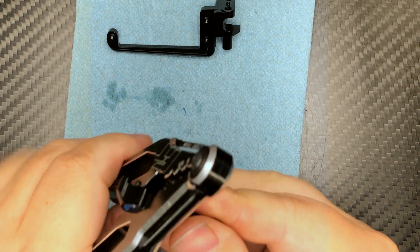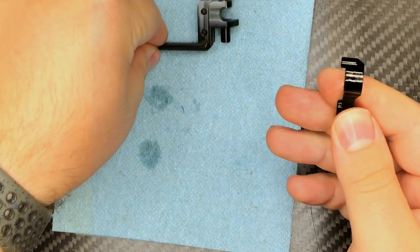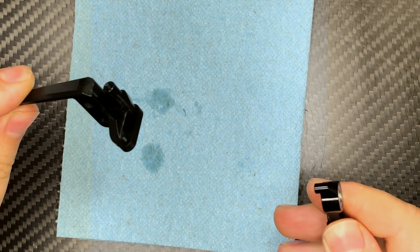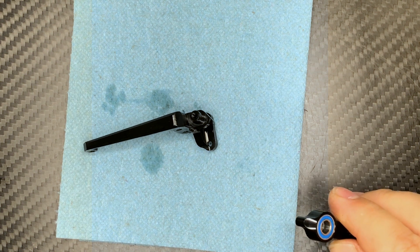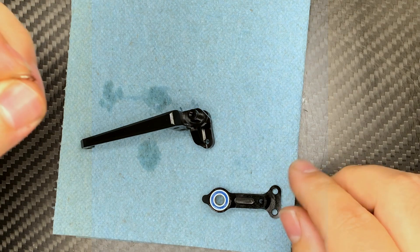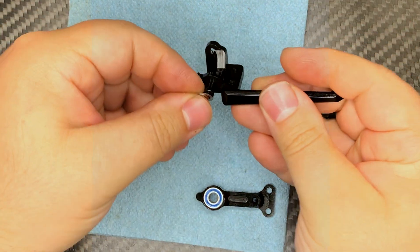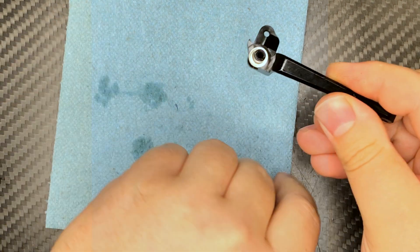These are going to seat 100% doing this. The next step is to take your servo and bell crank mount, and go ahead and take one of the 0.2 and 0.1 shims that come in the kit for shimming these to make sure it's perfect with no play. Set those right in the center there.